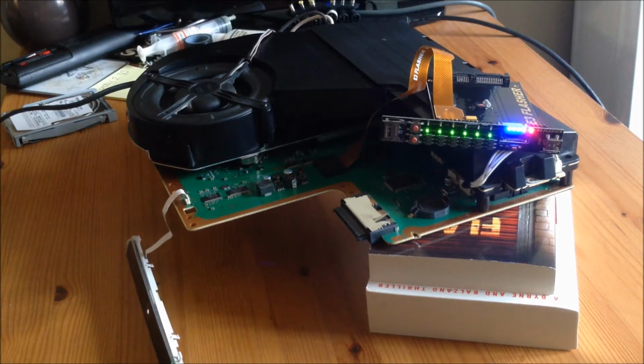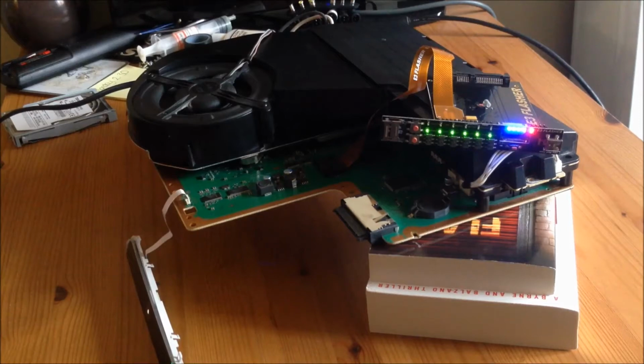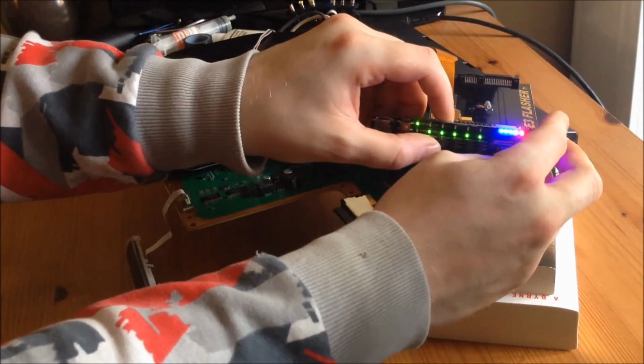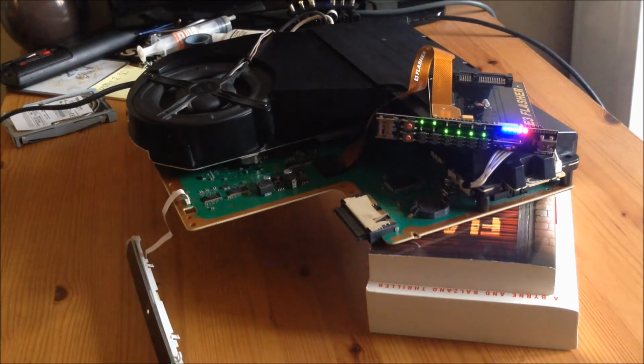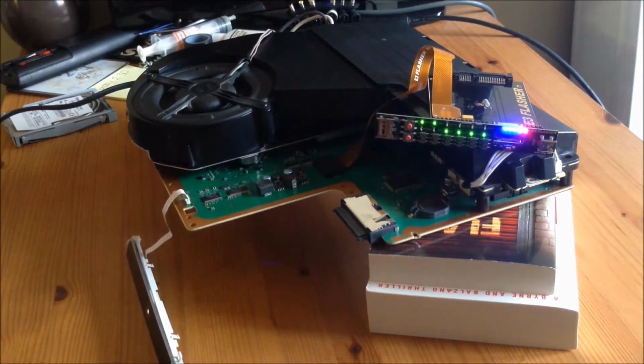But anyway, when you first get an E3 flasher, the first thing you're going to want to do is take the Samsung update, which I'll leave a link in the description for. Take that file, drag it onto your SD card in your PC or laptop, and then put your SD card into the E3 flasher, obviously in the clip cage where it goes. You want to have the first two lights up, and then press the top red button here, and that will start updating the E3 flasher itself.